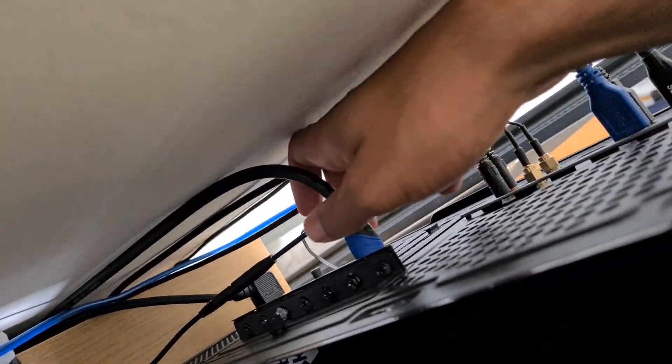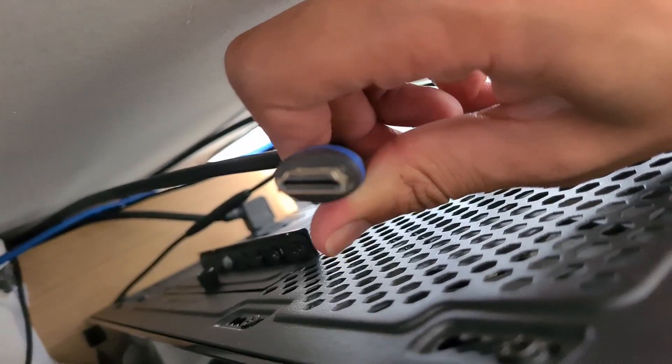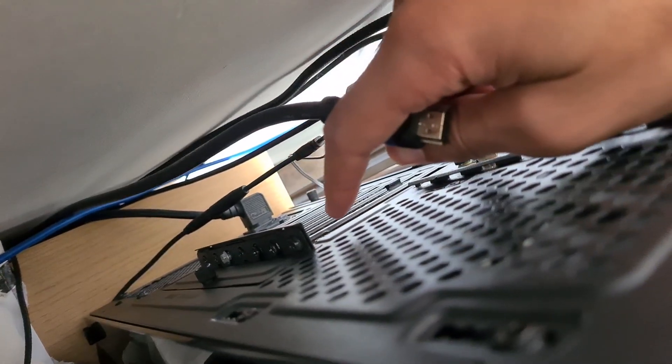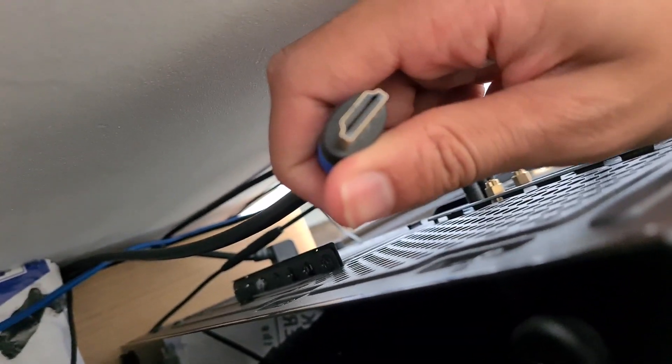The first thing is to make sure that the cable coming from your GPU is securely fastened and going to your monitor. It would also be good to make sure that the cable and the GPU port are both clean and not broken. If your cable is very bent or it looks like one of the pins are missing, you might have to replace it — and that could be your issue.